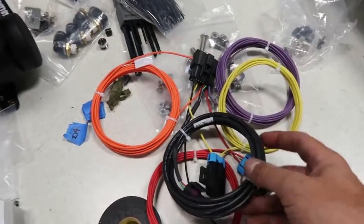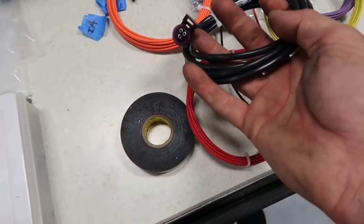One of the things that we have on here is actually a pressure sensor switch with a nice weather pack plug on it. We did not opt to run the upgraded pressure switch, which plugs directly into this harness. It's another 50 bucks. What we're trying to do here is show you guys that you don't have to spend top dollar to have your car on air. This switch speed system is very affordable. It's a very basic air system that's pressure based. So that said, we didn't upgrade to the plug and play pressure switch, which would have been $50 well spent in our opinion. Yep, it's less wiring. So basically we're going to wire a relay inline with the pressure switch, and it just requires a bit more work. So we're going to go ahead and knock out that wiring now.